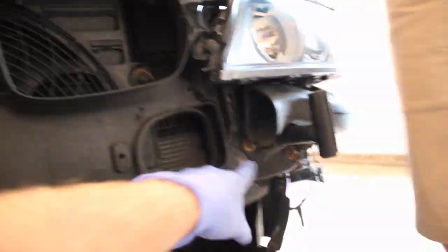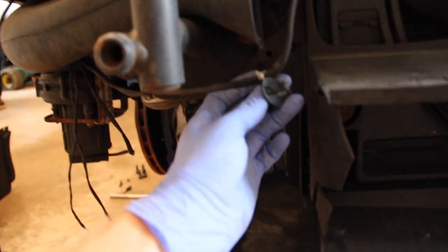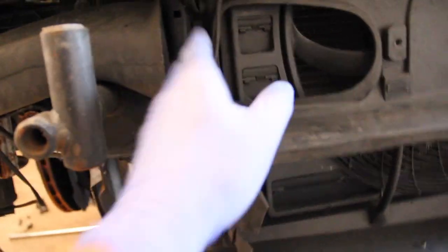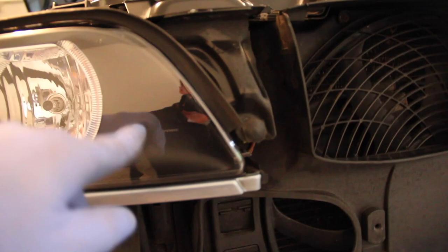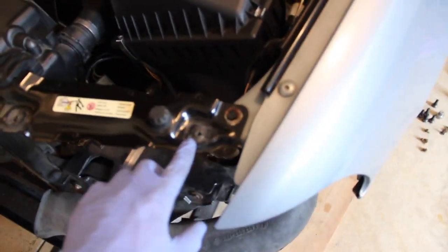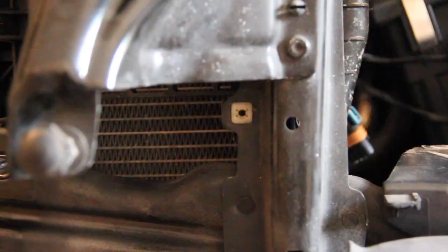On the other side there's a wire zip-tied to the trim — that's the aux fan wire — with a larger clip-type fastener that you can pry out and pull the peg. But there are more bolts behind the headlights, so the headlights have to come out. There are two 8mm bolts on top and two more on the bottom per headlight; unplug everything including the level sensor and remove the halo bulb if it's easier than unplugging. Once the headlights are out, you'll see one more 8mm bolt on each side holding the trim — that's why the lights had to come out.